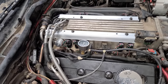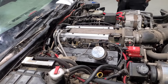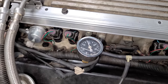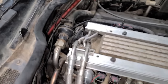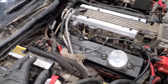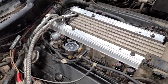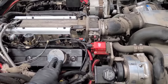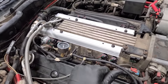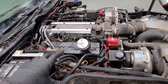Right now I want to fire the engine up and see if anything we've done so far makes it run better. We still have good fuel pressure and we do not have any kind of fuel leak — very nice. Still got a little bit of an exhaust leak we need to figure out. That's idling really nicely, but that wasn't really the issue — it was under load that it would start to break up. We'd have to take it out for a ride to see if it's really fixed, but let's pull some plugs so we can bore-scope and inspect the pistons.